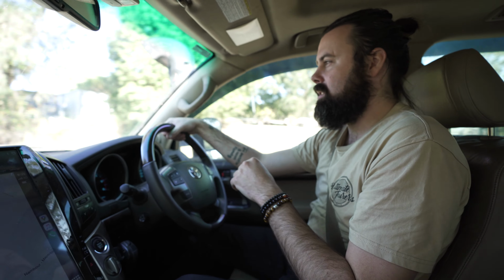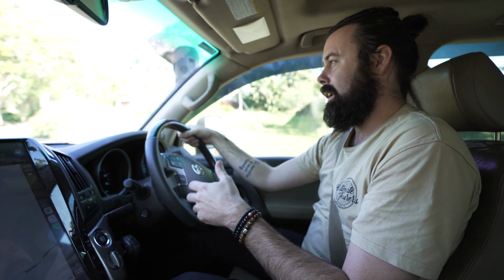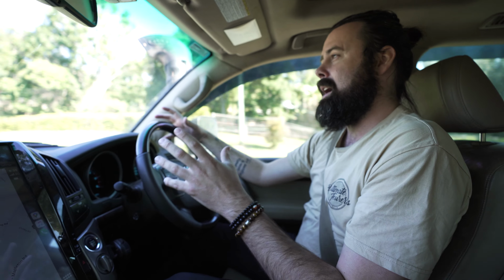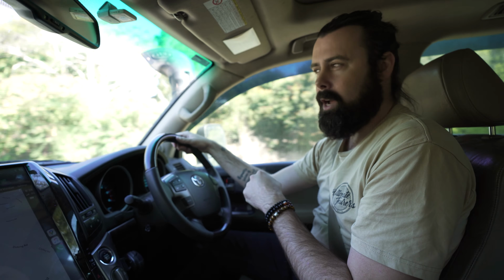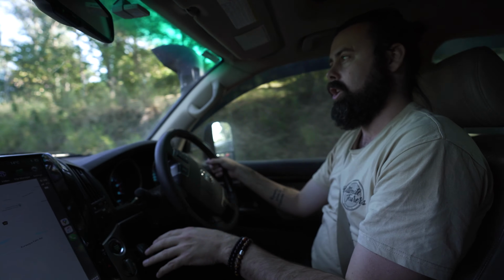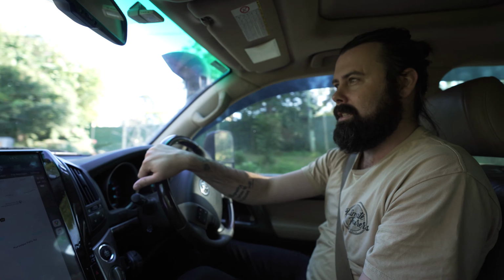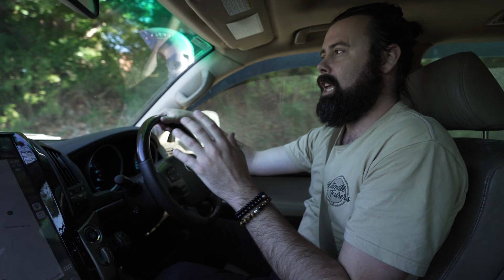So there's only a couple of instances where I would use the low speed function of the stock lock, and it's not very often, to be honest, that I do use it. It's really when the car is under a lot of load and you're doing between 40 and 90 kilometers an hour. Now, there are a couple of rules that I follow when I put the car into the low speed lockup mode. And the first one is put it into manual gear select.